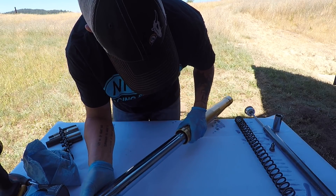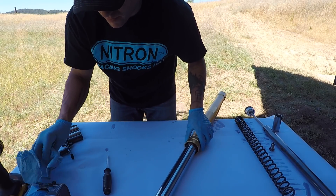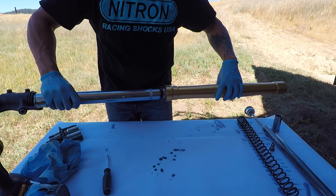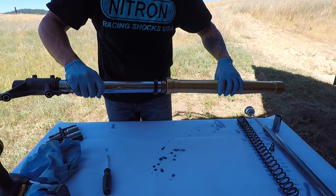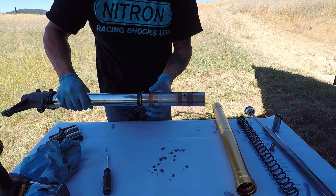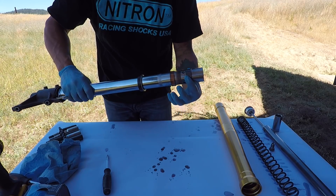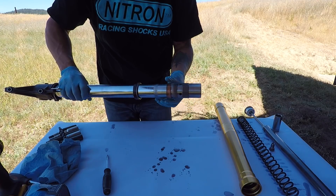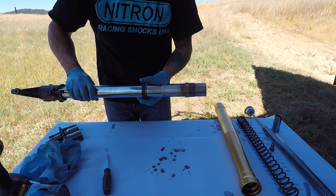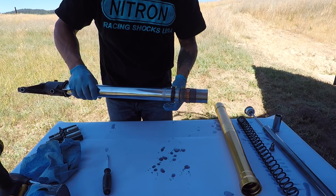Now you should be able to take a driver and drive that out. We've got the two apart. You actually don't need a driver — since they are new, all you do is give it a couple of whacks. Be gentle though, because if it's not coming out you could ruin these bushings here. Maybe a good idea to replace them if they look bad or if they're gouged up. These are in great shape since the bike's new, so we're just going to keep them. But we are going to pull these off, take our washer, and put these new fork seals in.